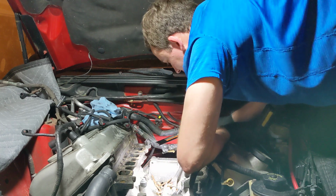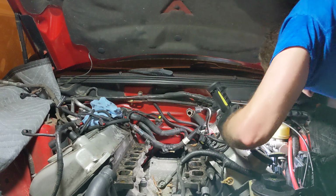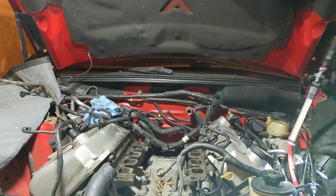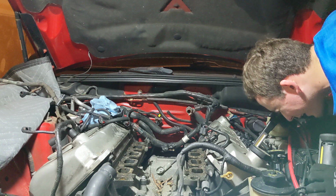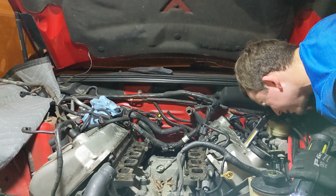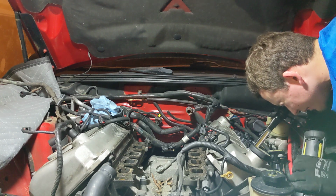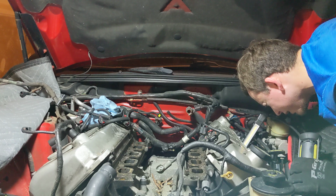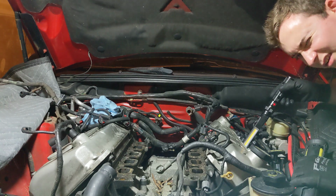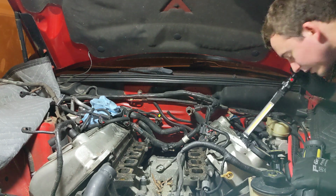I'm gonna replace all the intake valves. They're probably gonna get lapped. I can't. I'm sorry. I'd like to show you guys, but at the same time, there's nothing to see. I can't see anything either. I can see the tops of the pistons, and it's a little wet on this one. This one, I can't tell. It's dark. The piston's carboned up a little bit, it's kind of black. They don't look like they've been steam cleaned.